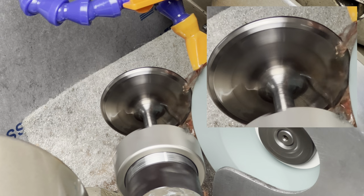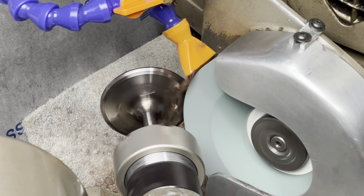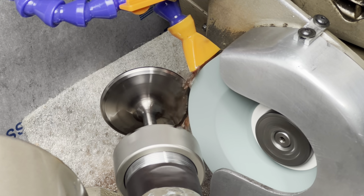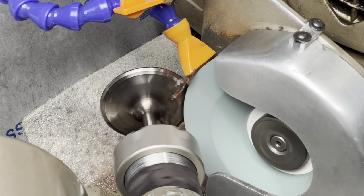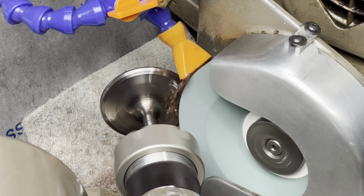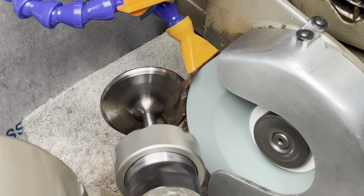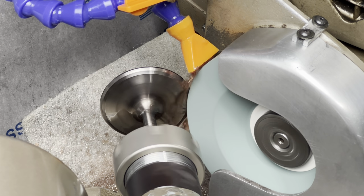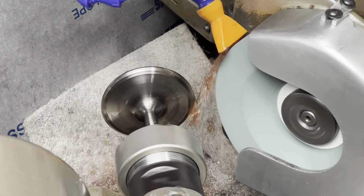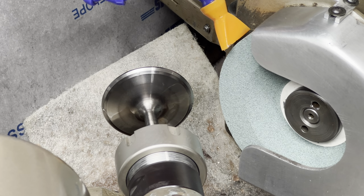Look at that. Nice and wet. A little bit of moisture never hurt anyone. I'll probably adjust the valve now, or adjust the stone now. I'm actually not liking some of the noises I'm hearing. Let this spark out. Now you hear that high-pitched sound, not just my voice, starting to go away. I'm just slowly working it across the stone. Once it gets quiet, probably this pass, yep, I can move the chuck away, and we're good to go. Beautiful. Look at that. Well, that's pretty.